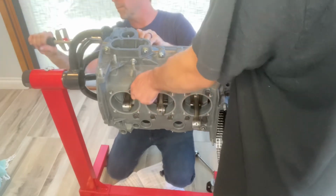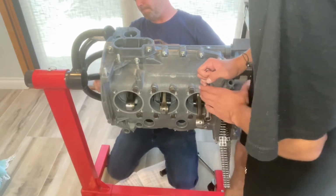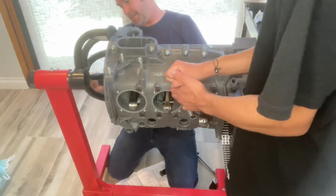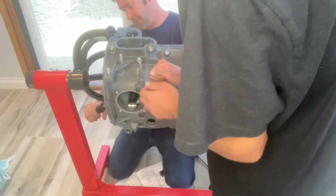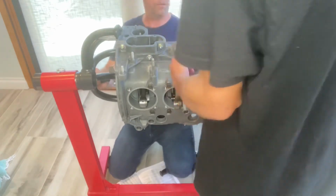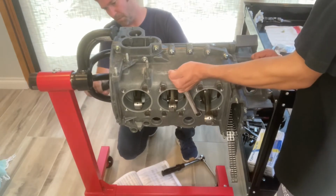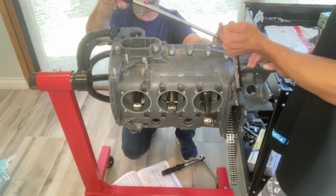I think there were 3 of them. One inside the timing chain housing area. I think there was a 15 millimeter nut, and then a couple additional acorn nuts inside the oil cooler assembly area. The torque settings for the case through bolts is 25.8 foot-pounds of torque, and the nuts that cover the perimeter of the crankcase are tightened down to 18.4 foot-pounds of torque.